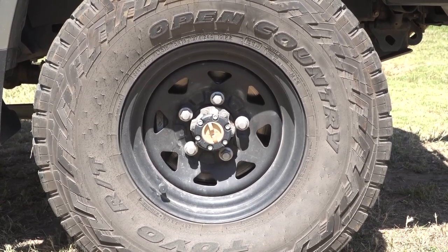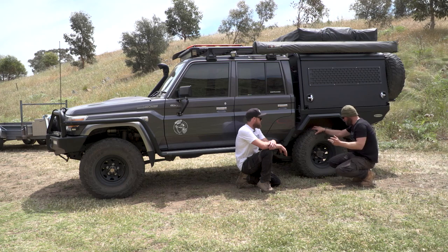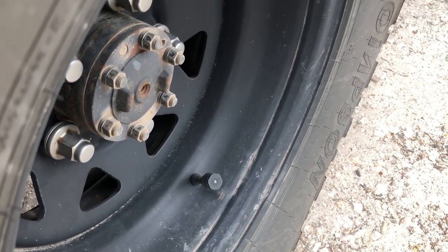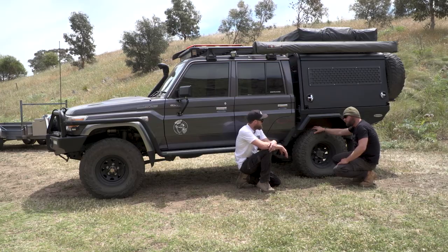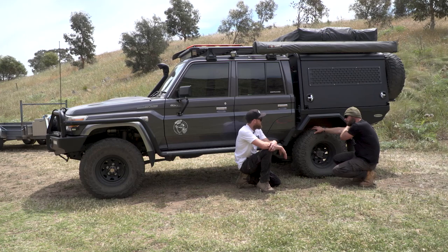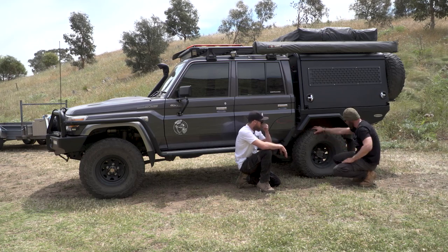For those who don't know, the 70 Series Land Cruisers — Troopies, Wagon, Single Cab, Dual Cab — all come with a narrow axle on the back because they allow for a wider axle for the V8 on the front. You're running negative 55 offset? Yeah. Same King rims I used to have? Yeah. No issues at all — bearing-wise it's been fine. They just check it every time it's due for bearing replacement. Your spares are running a negative 55 and a zero — two different offsets. 315/75 R16 equates to about a 35-inch tyre.